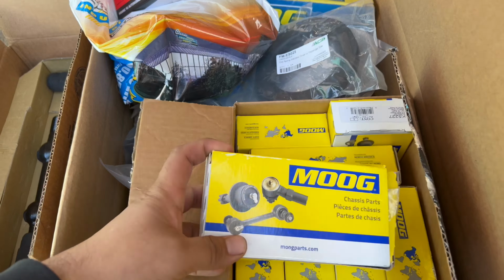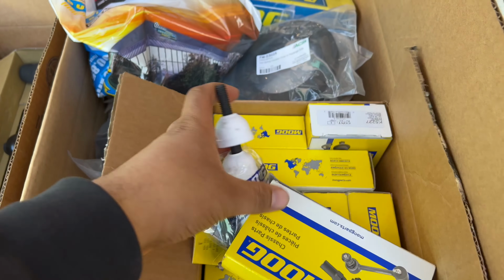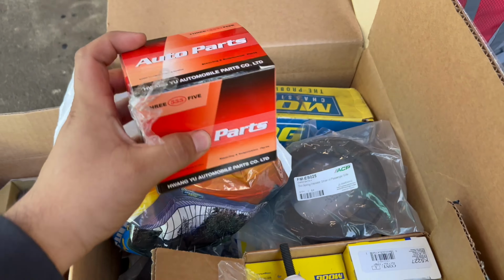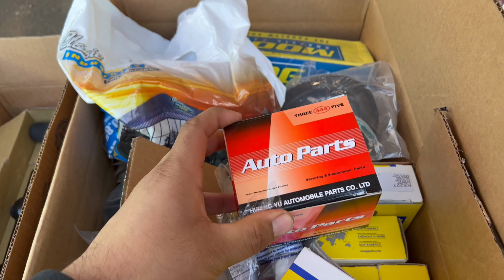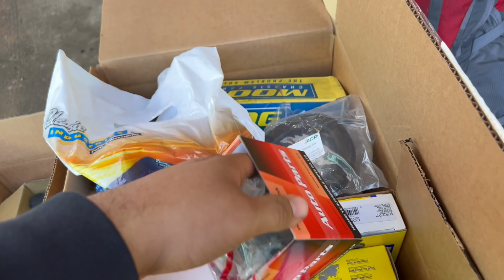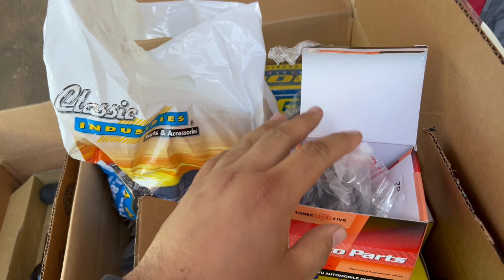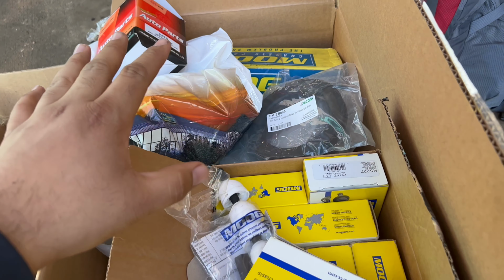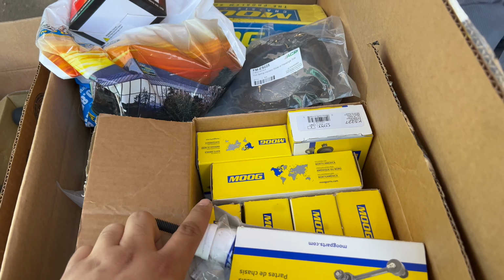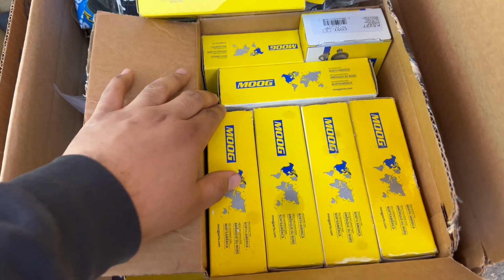But we've got a bunch of bushings and end links. I've got some upper ball joints right here. The upper control arms, they do not sell them, so you will have to rebuild your upper control arms. So this is the correct 3-bolt ball joint for that, and Classic Industries sells these. I will put all the part numbers in the description below so you can just copy paste, but a lot of this stuff I just ordered from Amazon, which is pretty crazy. With the 2-day shipping, I got all of this pretty fast.